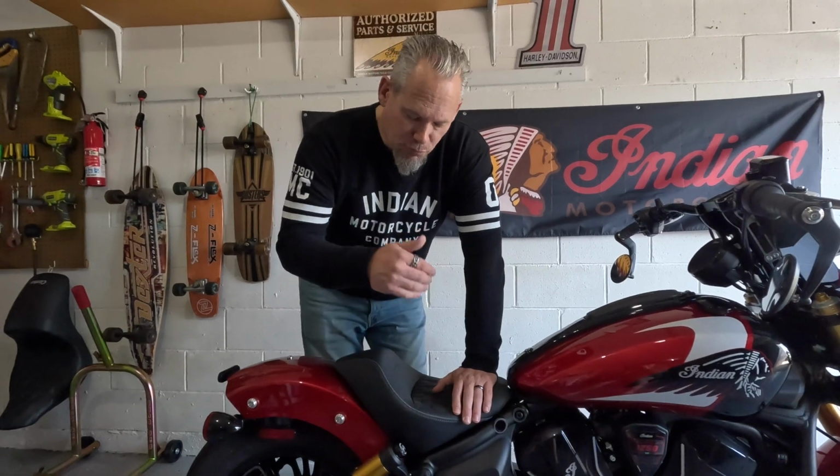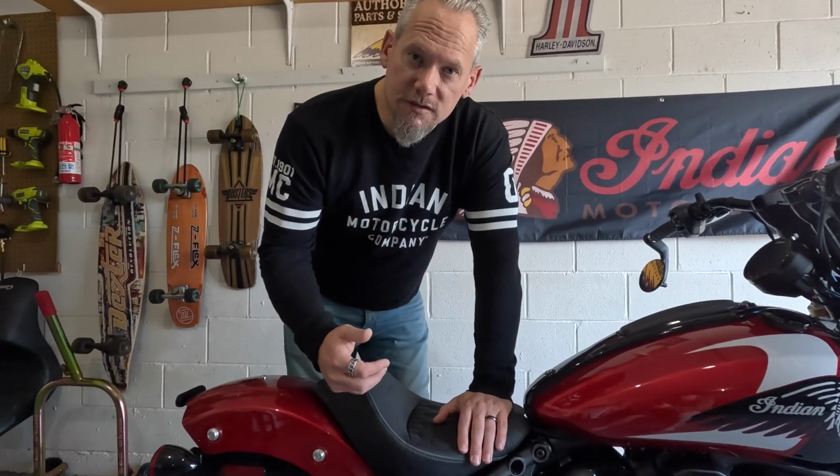So we're going to talk about the spring part of the suspension first. And the way I think about a spring, like any sort of spring, obviously, the more that spring is compressed, the harder it is then to compress it more. So what we want to do is get that spring set up for your weight on the motorcycle. If you're riding two up, you're probably going to want that spring compressed down a fair way, because the weight you have on is going to push it more. So you want to be in that higher sort of compression area.